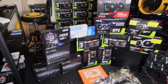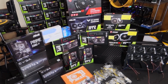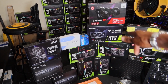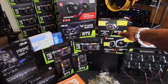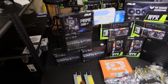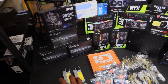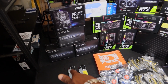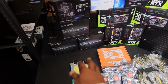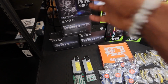This is a really good build. This is a really big build. I calculated each one of these 3090s is going to be taking roughly 300 to 315 watts, 310, maybe 315-ish. And then we've also got to add in the 6700 XT and then also the 1660. That's another thing when it comes to my decision on using the 3 ATX power supplies as opposed to the 2 1500 watt platinum power supplies. But we should be under a total of 2500 watts, hypothetically, if we go with the 2 platinum server power supplies. So we should be okay. I'm sorry, it's 2400 watts. If we stay under 2400 or right at the tip of 2400, I'm okay with that. Otherwise, we may have to go with the ATXs.